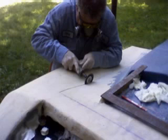Clean the body again, and this time follow up with a product such as Feather Fill. This spray-on product fills in the minor gaps and imperfections in the surface. You will have to repeat the sand, clean, and paint process several times until you achieve your desired level of quality. As you sand, use progressively finer grains of sandpaper. When you have a smooth, blemish-free surface, you're ready to use your choice of color for the final coats of paint.